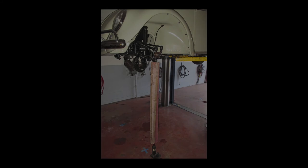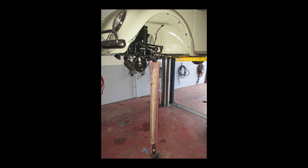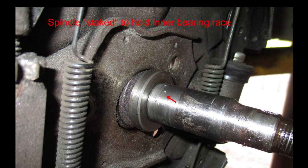You won't need to do this taking it apart, but putting it back together, you're going to have to use a jack and something like 2x4s to help you put those link pins back in. One thing I found when taking this apart - and this applies to all cars, not just bugs - the wheel bearing race moved freely on the spindle. The inner wheel bearing race should not do that. I made some small stake marks with a punch, cleaned my spindle and my race with lacquer thinner, and used some red Loctite. Then I drove that bearing race back on the spindle, as you see here.